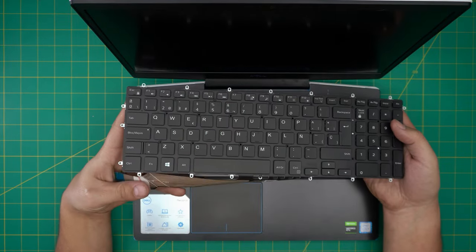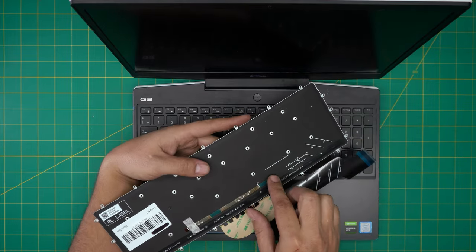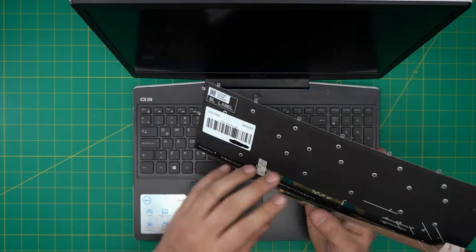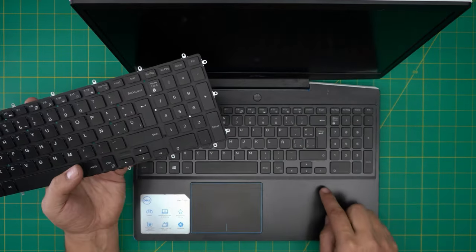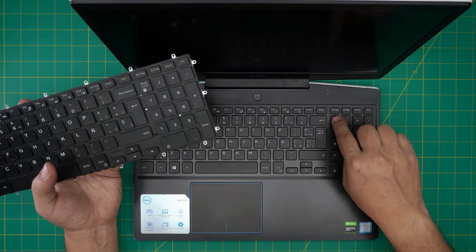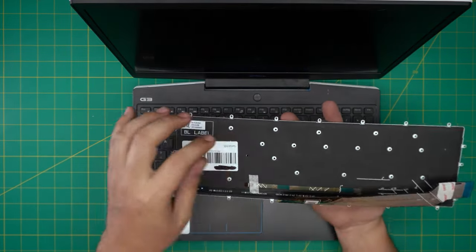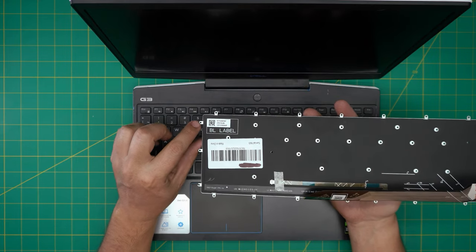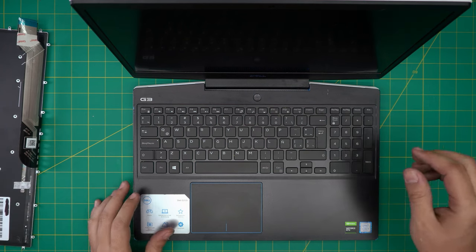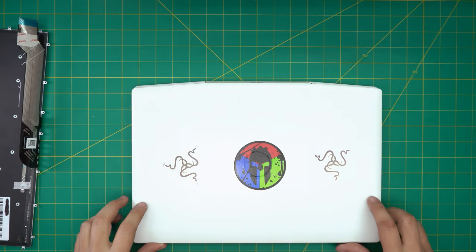I'll include a link for a new keyboard with the backlight — there's a cable for the keyboard and a flex cable for the backlight. These are called mesh keyboards, so the cable goes from underneath up because the palm rest is one piece. The cable comes from the outside underneath and is pinched down by plastic rivets. I'll go through the whole process. First thing: power off the laptop — you won't lose any files.